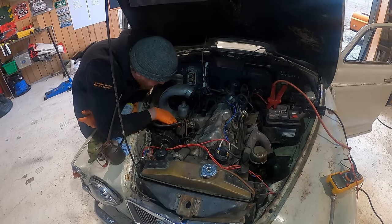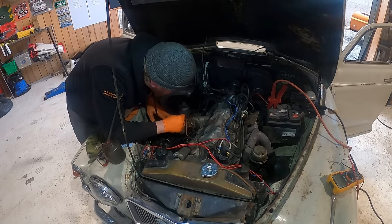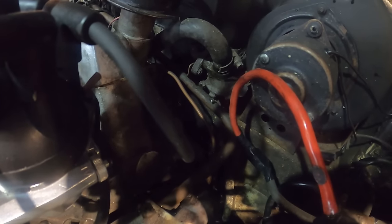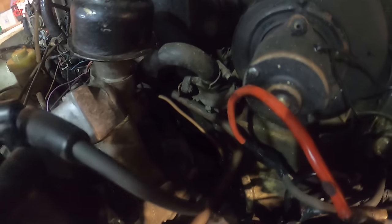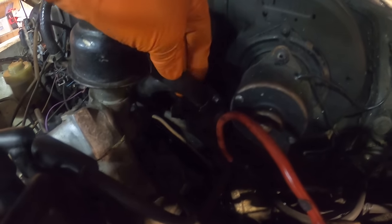I mean, there's fuel in there. It would seem that that is not our culprit. Have we got like a catastrophic air leak or something somewhere? And if so, why has it only just come now? What was that? While I'm looking around for obvious things that have gone wrong, I have noticed there's a drip, drip, drip from where it goes into the heater matrix there, from a pipe. Oh, yeah, you can see the pipe split there.